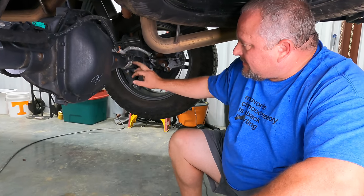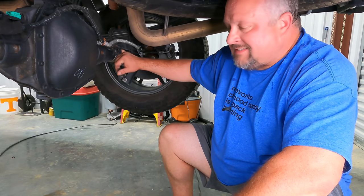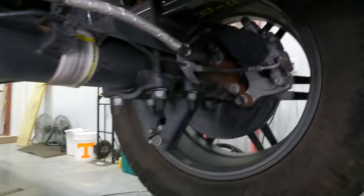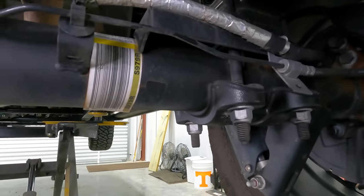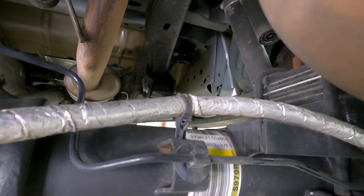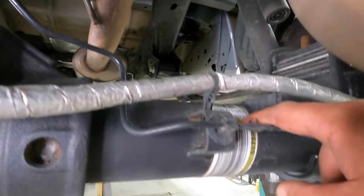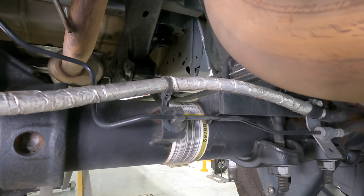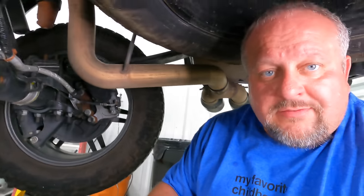One thing I am going to miss is this sticker on your diff. If you ever need to reference exactly what diff you had, let me take you to the sticker right here. This is the sticker at the factory - it's going to tell you what rear end it is. This tells you it's a 975; you can put in this code and it's going to tell you your gear ratio and everything. So if you ever need any parts, it's going to make it easy to find exactly what you need. If you can, don't paint over that - you may even want to take a picture of it for future use. There's a little bonus tip.